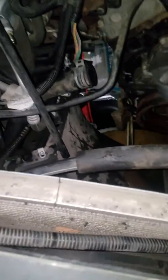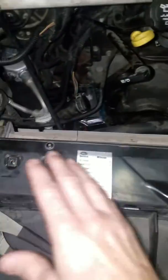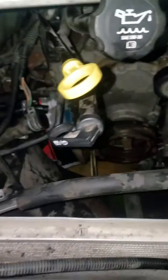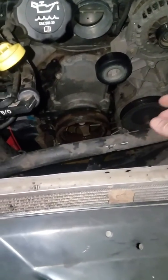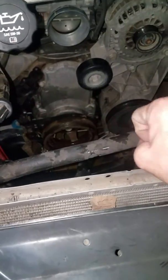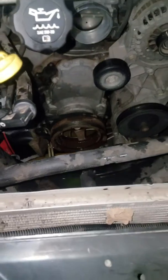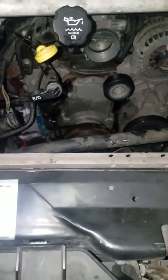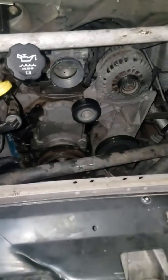Once you take the intake off, take off the upper fan shroud. There'll be three 10 millimeter bolts on each side that you'll undo, and then there'll be a couple more up top that you undo. Then you'll want to take off the plastic C clamps — just take a little screwdriver, pop them open, and take everything that's attached to the fan shroud off. Then you'll kind of have to wiggle the fan shroud back and forth, and you'll be able to pull it up and over.